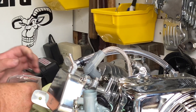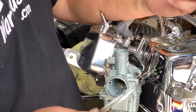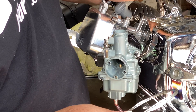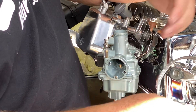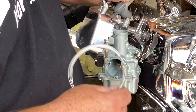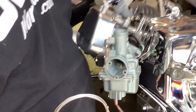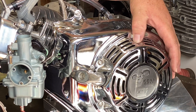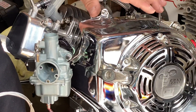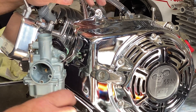The Mikuni carburetor kits only come with an inner cable — that's for cart racers that are using the hydraulic tube as a throttle line. We have a kit at OMB Warehouse that will bolt here — you take a short piece of inner cable or conduit and run from the top of the carb to the front of the bracket. I'll include that link in the description, and that'll help you get this set up.